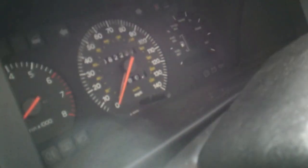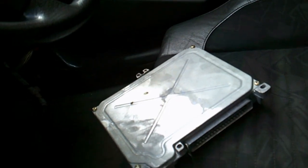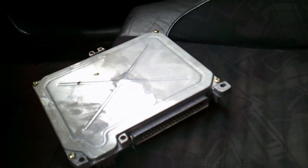The big difference I can see doing that — ABS goes through self-test, lambda light doesn't come on at all, so lambda must be via the ECU, and the ABS light goes out after a few seconds. Now that suggests to me that the ABS is a separate system. I know it's a separate system and I know it's not related, so it's not ABS — we're still pointing at something to do with the ECU. I think the next thing is let's take a look inside the metal box and see what the ECU on a 1994 Volvo 480 ES looks like.